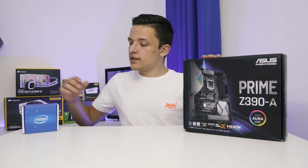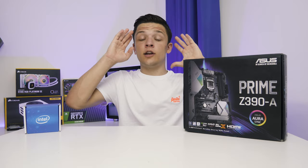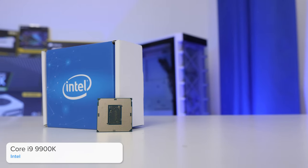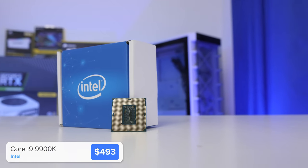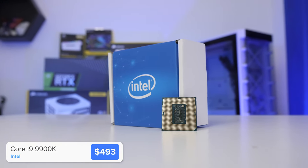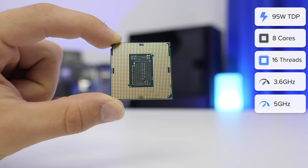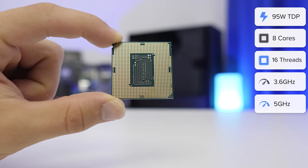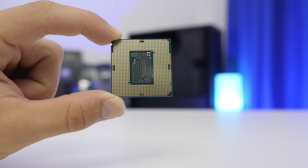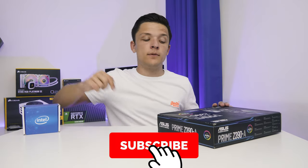As with any build, we're going to start off with the CPU and motherboard. I opted to go the Intel route for this build, and I know the comments are going to be a literal uproar. The reason I chose to do so is that the Core i9-9900K, which isn't a cheap CPU, is fantastic for gaming and editing. Intel, in some circumstances, does still hold the gaming edge — especially with single-threaded performance — over the Ryzen 3rd generation lineup. Are they probably a little bit better value for money? Yes, but with a build this expensive, it doesn't really matter. My Ryzen 3rd generation builds are going to be coming very shortly, so make sure you get subscribed so you don't miss them.